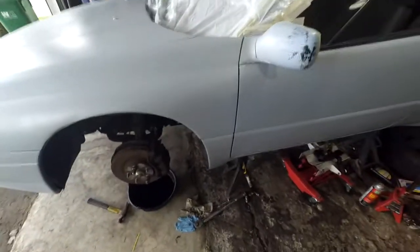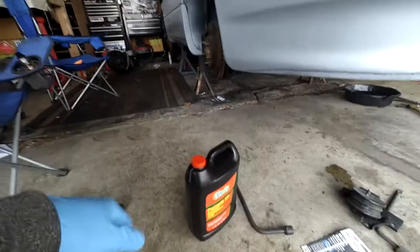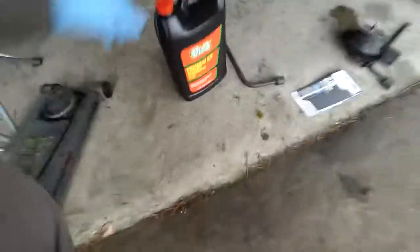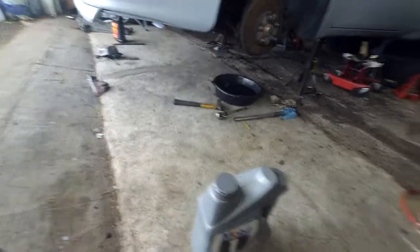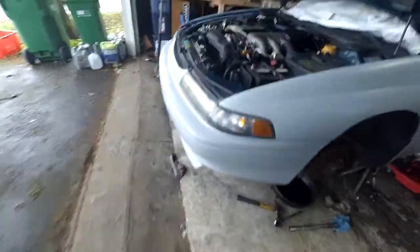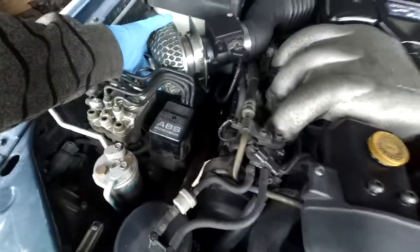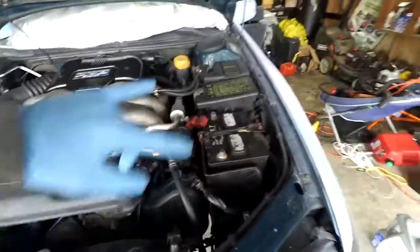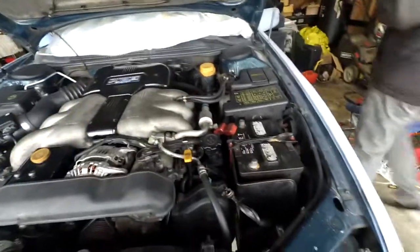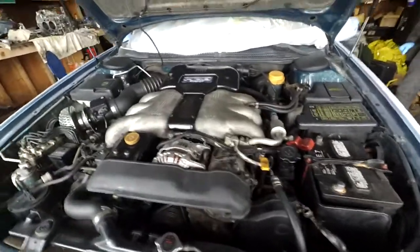We threw limited slip Castrol gear oil in the rear diff, and then we've got some O'Reilly's ATF. I've got some Mobile 1 — this engine takes 6.3 quarts. I also painted the engine covers and threw on a pod filter just to see, because this has the twin throttle bodies and I just want to see how good it's going to sound. Basically I just need to hook up the battery, put engine oil in, start it, and start filling up the transmission until it's full. Let it warm up, make sure it stays full, and hopefully it doesn't leak everywhere.